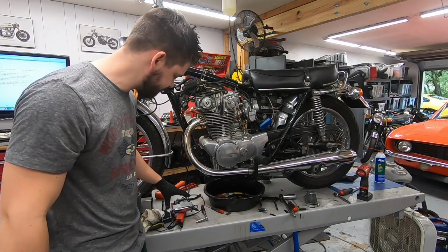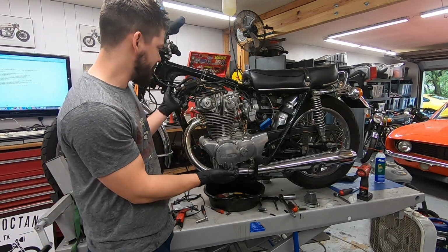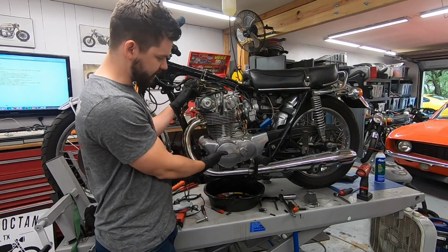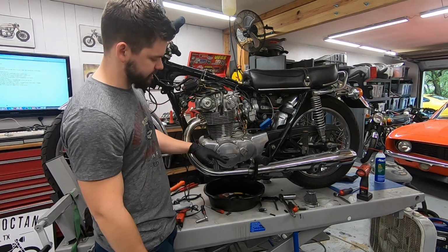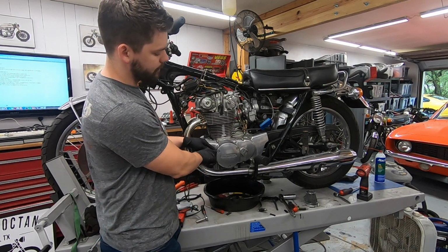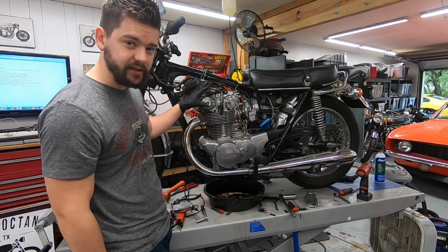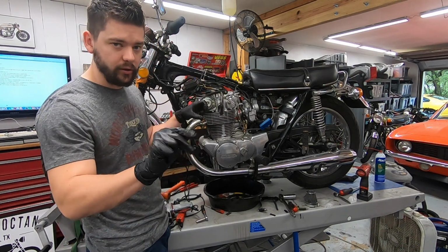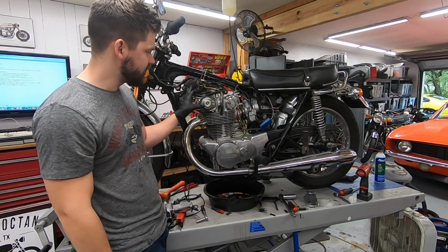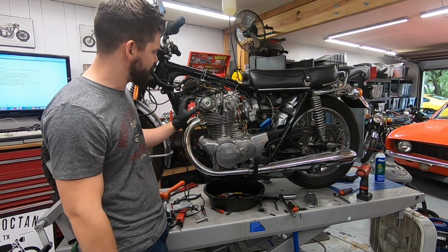And how I did that is using a timing light. You start with, I don't think it really matters, left or right side. And you're just trying to get the fire mark to line up when the bike is running with the mark that's on the crankcase. And then you can adjust the entire points plate. Ideally, according to PAMCO's instructions, it should be pretty close and you can just fine tune it. That was very far from the truth.